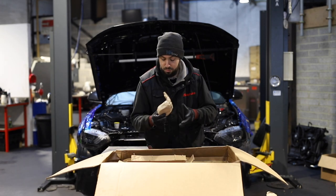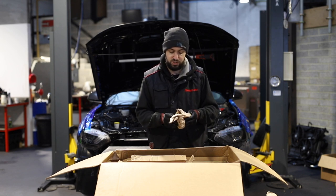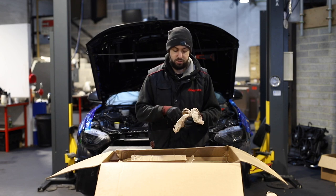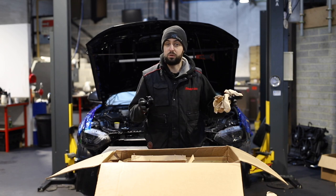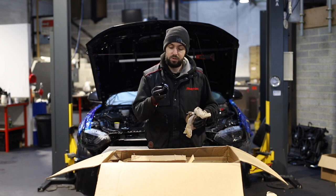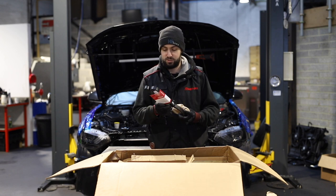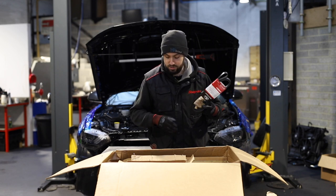In here we've got more pulleys as well. That is the ribbed pulley of a six-ribbed system. Obviously depending on what ribbed system you buy, you can get the ten-ribbed system which is just for overkill for belt grip, so there's no belt slip. We've got the belt as well by Gates — very renowned belt company, an OEM manufacturer for many cars.